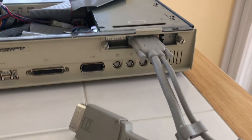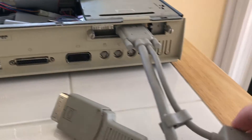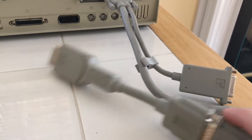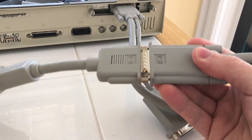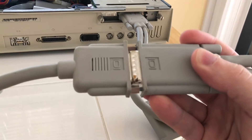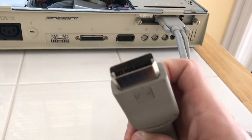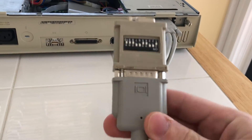So what the heck is this cable? It's a breakout cable. Out of here is coming video and game port. So it has a Sound Blaster and you get a game port, which is fantastic. Then the Medusa cable branches out, goes around into this connector, which is like a standard Macintosh monitor connector. That would plug into your NuBus video card if you had one, but in this case we don't have one because we only have one slot. So, HDI-45 adapter, dongle, into this dongle, and then I have another dongle on the end of that to adapt it to VGA.